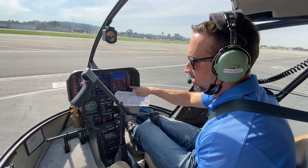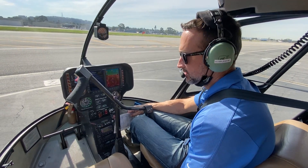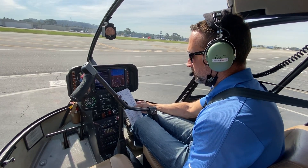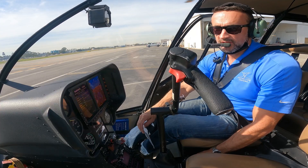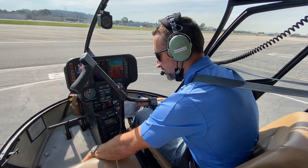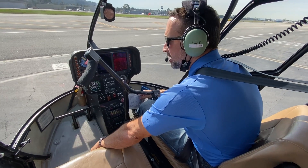The clutch light should go out — Robinson says it has up to 90 seconds to engage, though it should be faster. If it doesn't go out and it's still engaging, something is wrong; you may need to pull the breakers. Once the clutch light is out, roll the throttle away from you to between 60 and 70 percent. Get very used to the feel of the circuit breakers, especially the clutch start circuit breaker on the passenger side — it always has a red band around it.